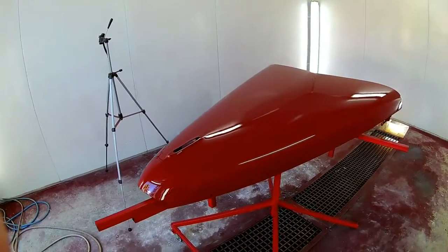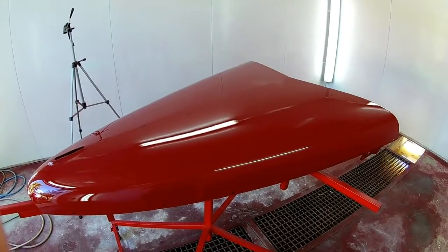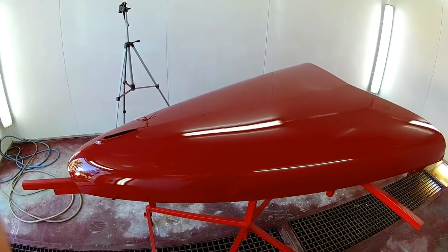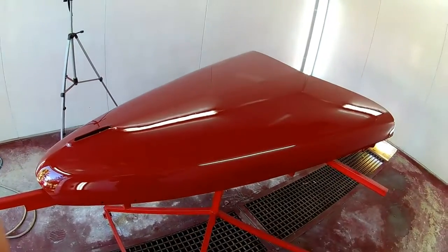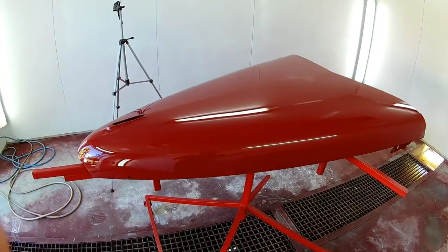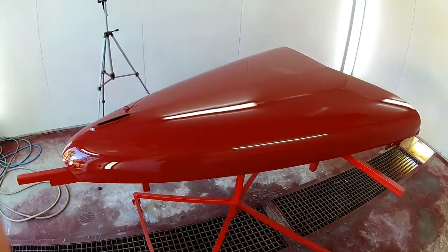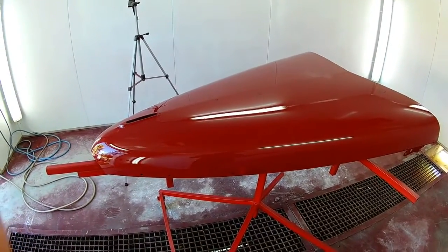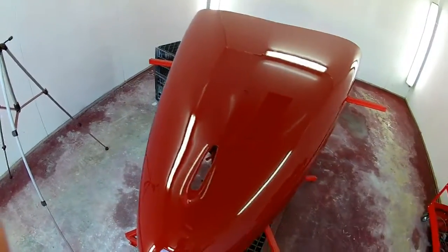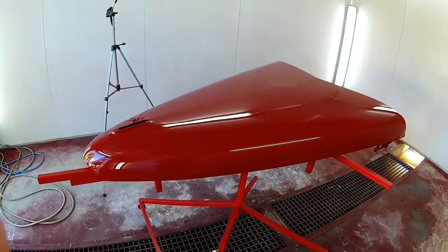And because what I do is custom painting, generally my film build is much higher. This hood has 4 coats, if you include the first sort of semi-wet coat of paint of oxblood red maroon, which is the original color for this Cadillac. And then it's got 4 coats of high solids clear over it. So when you do that many layers, expect a bit of dust and that sort of thing. We're probably going to sand away an entire layer on this car.